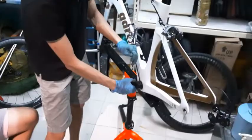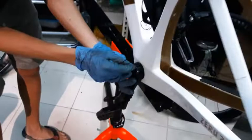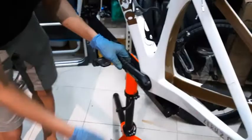After this part, there's a lock, as they call it. It's a very small one. All you have to do is take a smaller size Allen key, like a size 2, and slip it in between the crank slip here. There's one plastic piece. All Shimano cranks have it. Usually you just lift it upwards and then it will come undone. You can see this small little plastic piece. It's quite hard to see on the camera; you can review the recording later.